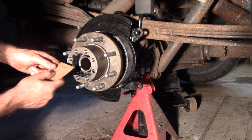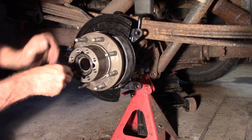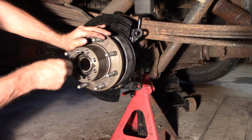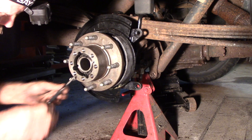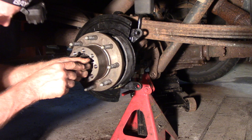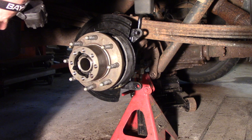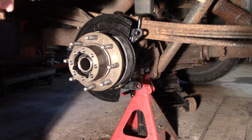I marked where it was — it's got to go way in. I measured: 12 turns coming off. It taps down pretty easy. There's 12 — back her off to right there. That's 12 — I can stick my keyway in right there. Let me take a measurement — that's right on the money, my little tick marks. I don't think everything's off. I'll put that little keyway in. I've got a mark measured on this brake shoe — see if that's right, and if it is, I'll pop that spring in.